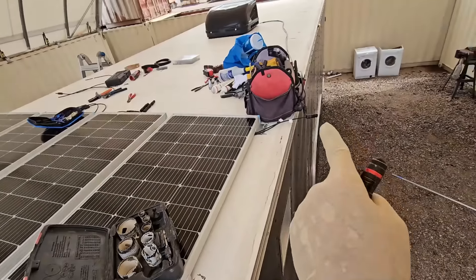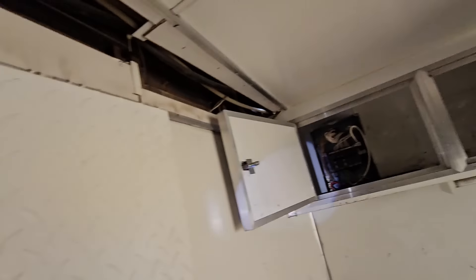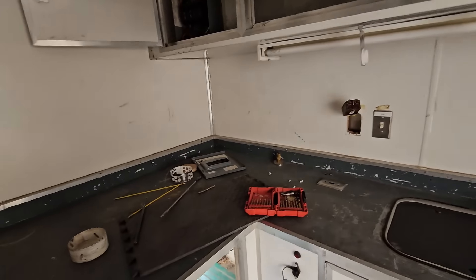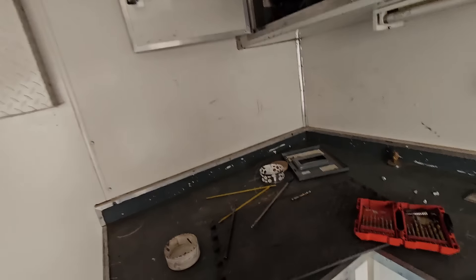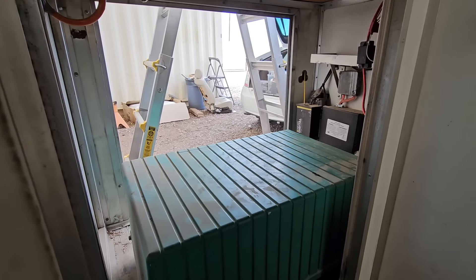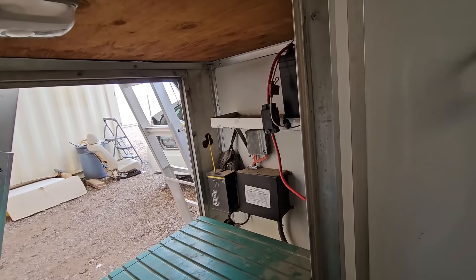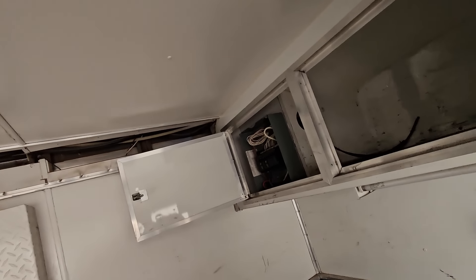They do have corner cable runs available, but I don't like exposed wires. I could have put conduit on the outside, which would have been a lot easier, but the walls are hollow so wiring through is easier — except there's a big generator door compartment with no easy way to run down. I found a channel over there and traced it up over to here. Hopefully you can see the solar wiring I just fed down — I'll feed the other one down, tie everything to my fish tape, and pull it through. I had to drill an access hole just to get access.